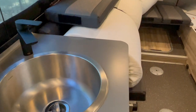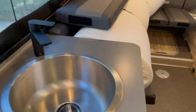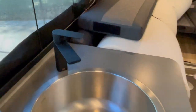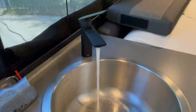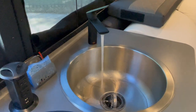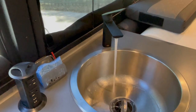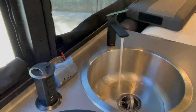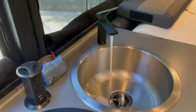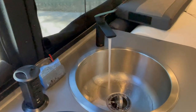Okay, so I've drained all the water out of the tank, come back, and closed up the line, along with the two low point drains. Now I'm back inside the camper. We've drained the sanitized bleach solution out of the fresh tank and closed the low point drains. I've hooked up the city water on the outside, and I'm going to flush just cold water through the lines — here at the sink and in the toilet — to get any bleach solution out. I'll do it for both cold and hot to make sure there's no bleach left in either line.